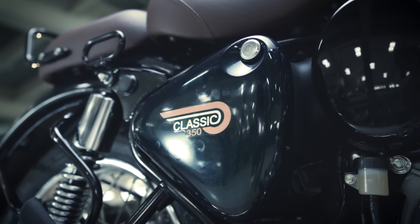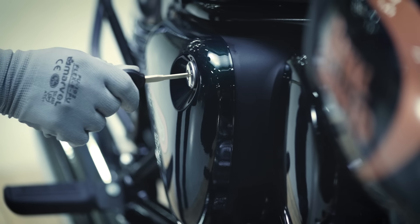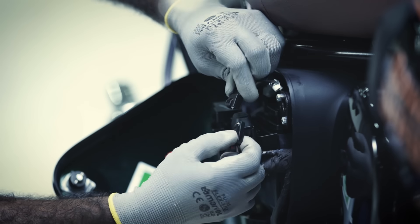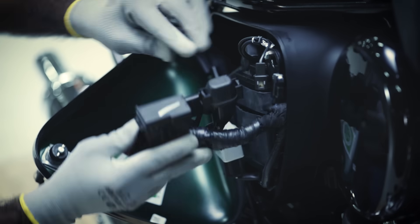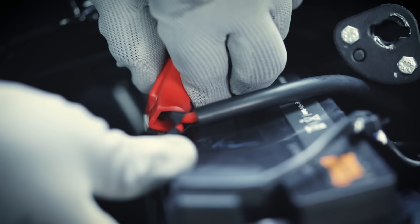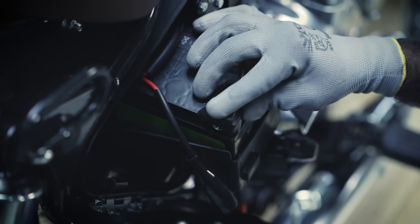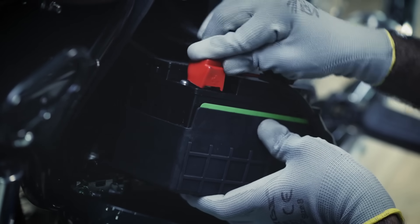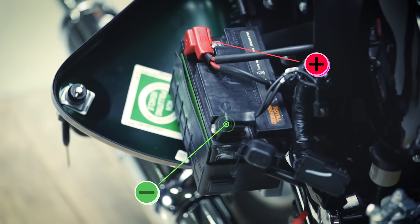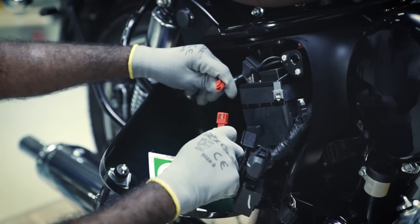Next, let's check the battery. If it is not in order, the motorcycle may not even start. Open the battery panel covers with the motorcycle key and check if the battery terminal is firmly fitted in its place. Apply some petroleum jelly on terminals to prevent carbon deposition. Cover both the terminal clamps and the rubber boot — black on negative and red on positive. Make sure that the battery terminals are covered properly. Fix the battery to its place, fasten it with the rubber strap, reconnect the cables and close the panel cover.